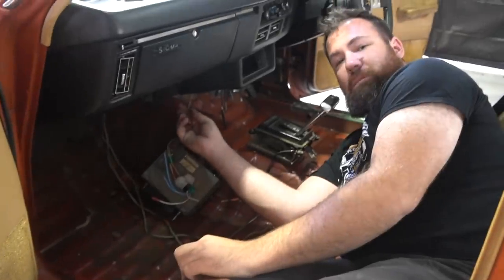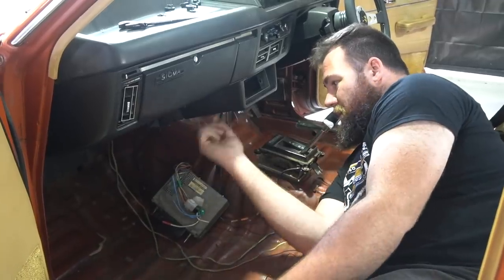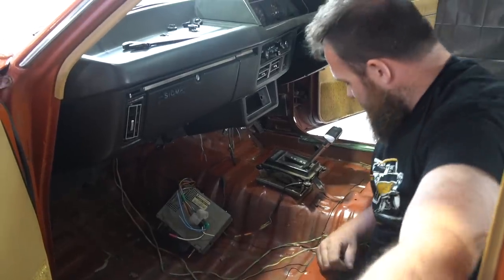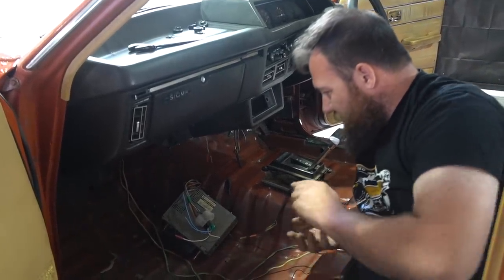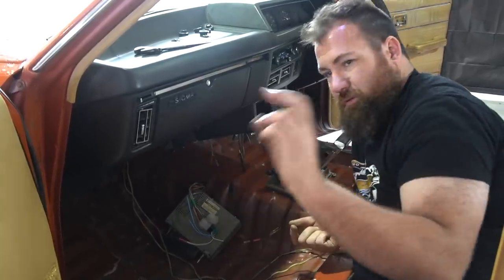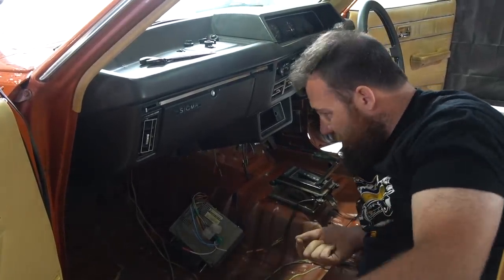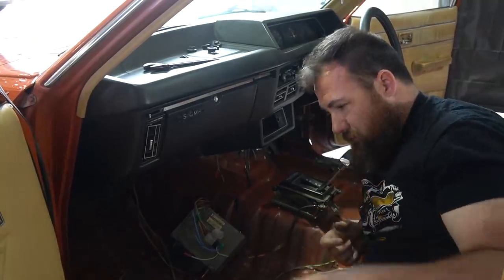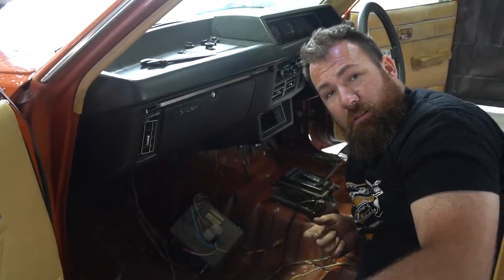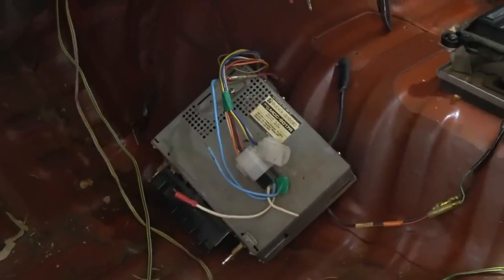So that's the two speaker wires for the rear speakers, right? Normally you wire the head unit to have each speaker, like positive and negative of the speaker, connect to the speaker. But the way they've wired this, the positive wires or trigger wires, i.e. the logic that this has been wired up in, are wired to the head unit, but the ground wires or negative wires have been literally just wired to ground. So I'm not quite sure how that even works. Whatever.